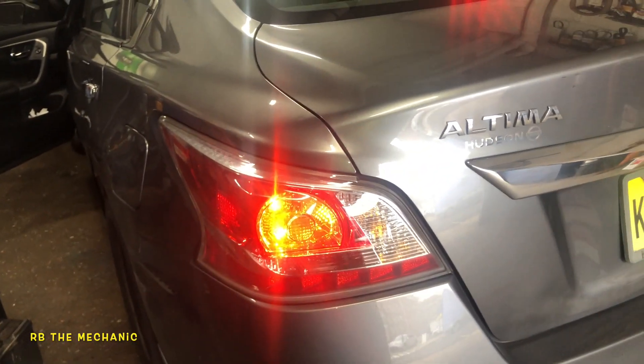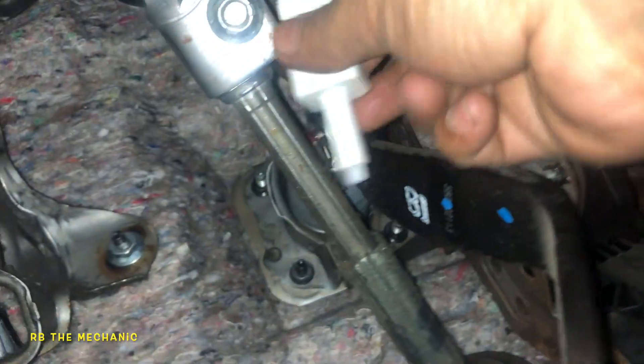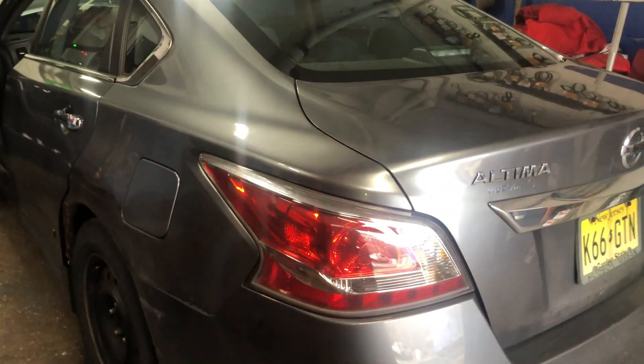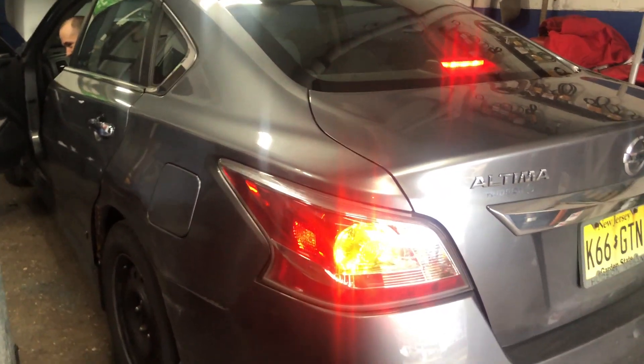Shake it. You shaking it? You see that — no flicker at all. So the car should start up really well again. We got the brake switch out. We originally thought it was a bad brake switch, but it's always a good idea to change it. So the reason the brake light was on is the switch wasn't in. All we need to do is put this back in, push against it, and the light in the back should be off. I'm gonna have my friend start the car up — it should start in one crank. He's gonna press the brake. Bada bing bada boom — press the brake, let go, press. There you go. Thank you for watching.